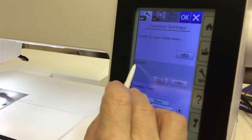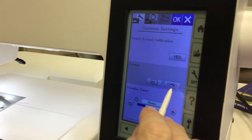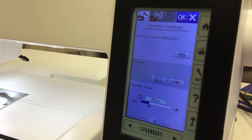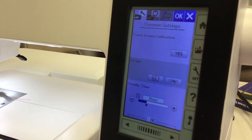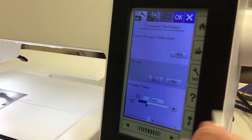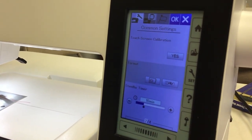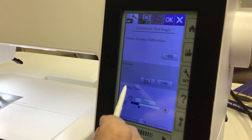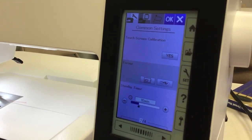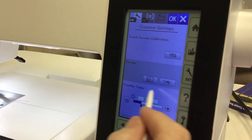The next category down is format, and you'll want to format your memory or format a USB. What that does is it creates files within the USB for you to save your embroidery designs. Janome uses the JEF format, and when you format your USB, it's going to create an EMB and an EMBF folder for you to put your designs in. The next icon down is the timer — that's how long it will run before it kind of shuts itself down. It doesn't turn off; it just gets quiet and the lights go down.